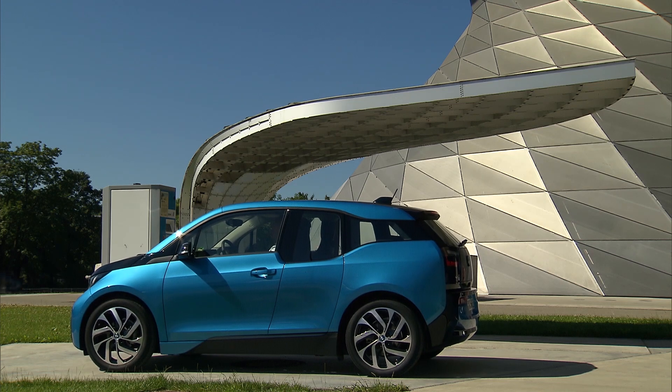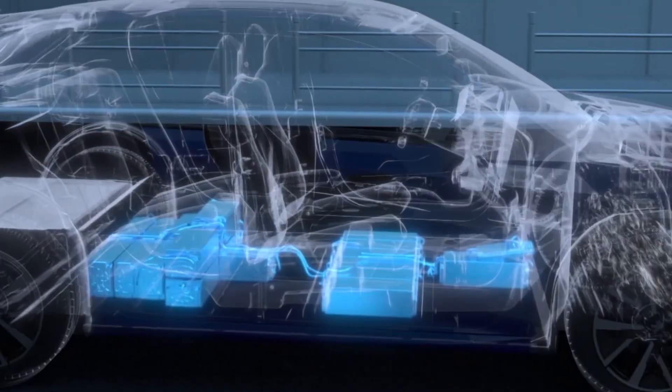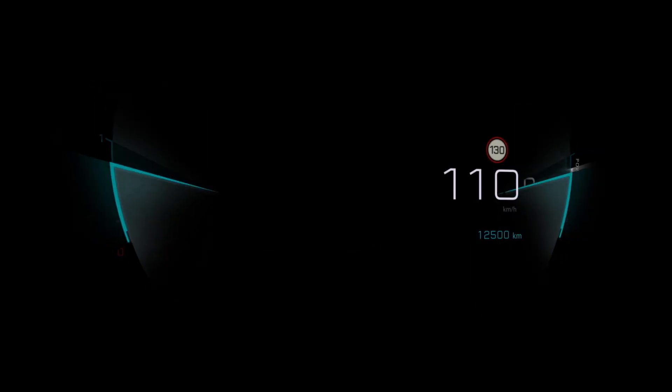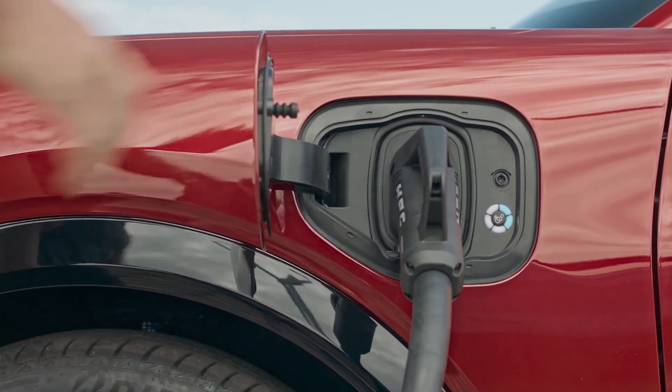It's important to give a bit of context. At the time of developing, most EVs were limited to DC charging up to 50kW, namely the Nissan Leaf. Technology in EVs has developed in tandem with chargers. We're now seeing many EVs in showrooms with DC charging capabilities, many of them between 70 and 130kW — the new Hyundai Kona, VW ID.4, and Peugeot E208 being some popular examples. Even if they plug into a CCS charger capable of delivering up to 350kW, it's the car that is the limit. But the gap is closing. We're now able to buy a number of cars capable of taking well over 200kW charge speed thanks to the CCS combo plug.